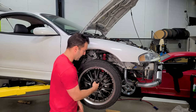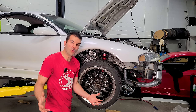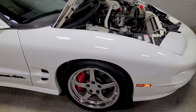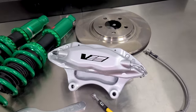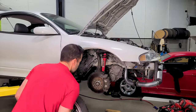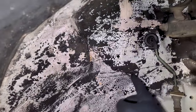These old wheels served their purpose for the last 20-something years, but we need new wheels, new tires, and new brakes. The brakes on this thing are pretty small, especially with the fact that I'm hoping for about 450 to 500 wheel horsepower. We need big brakes and they look cool. I'm taking a page from my turbo Trans Am WS6 — these are 2004 to 2007 CTS-V Cadillac Brembo brakes — much larger caliper, much larger rotor. And we're going to lower the Eclipse with some coilovers.